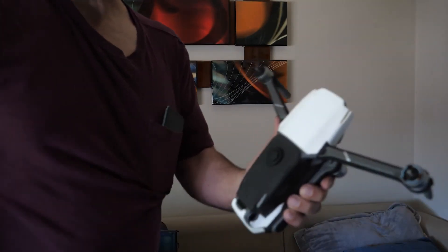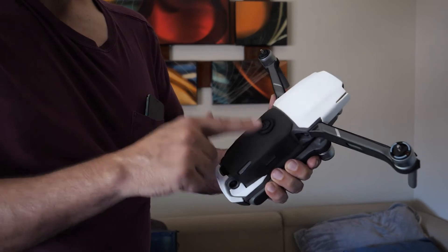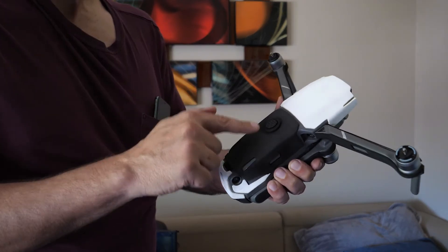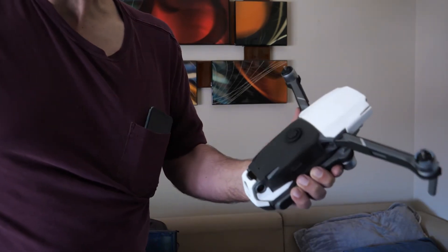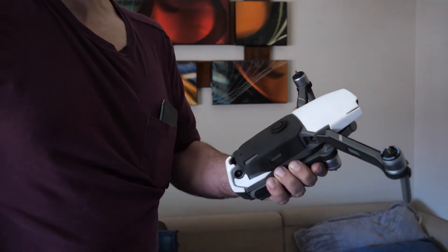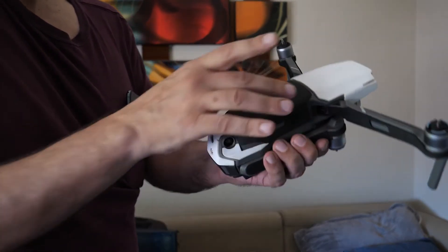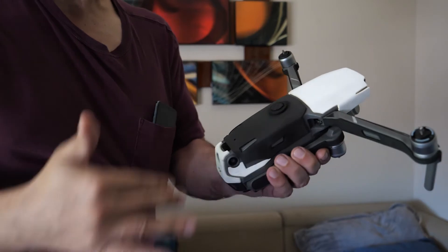The other issue is the power button. We know this from people who had Mavic 2s and all the problems that happened. One of the first things that happens when your power button gets corrupted from rain or moisture is the battery will give you a warning saying it's no longer able to connect to the drone — once that happens, your battery is fully compromised. The battery may also start flashing, which means it's compromised. And last, the battery can actually start to swell, and sometimes it swells so much it pops the battery right out.